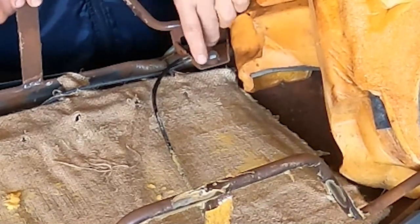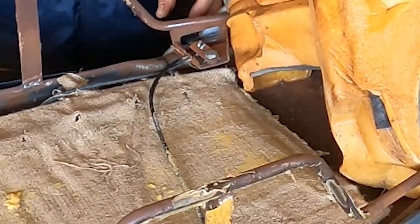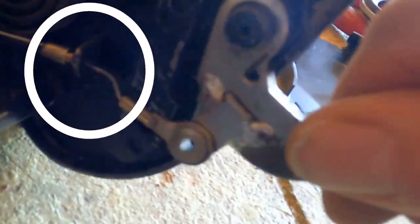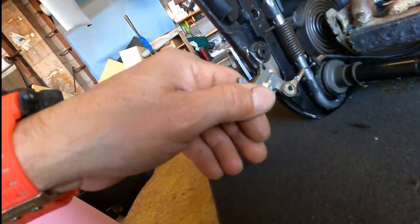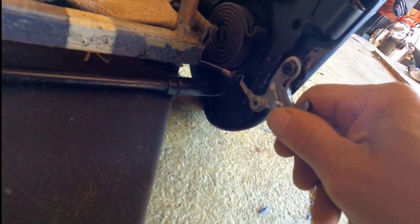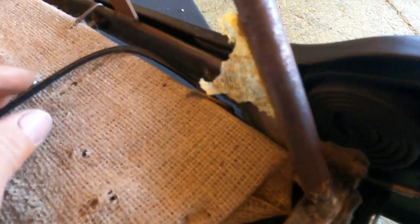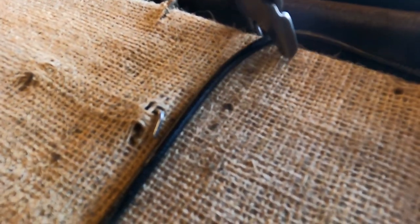I move the handle up and it stays up — it doesn't go back. Some handles have a spring to make it go back, but this one doesn't need that; the spring is on the bottom. Look right there — when I push it, that cable doesn't go in, it bends, and it should go in. This side is so loose. On this other side, when I push it, it comes back by the cable fold. So I'm going to place this cable correctly — I'll put a staple right there, not squeezing it all the way, just enough to hold that cable in place.